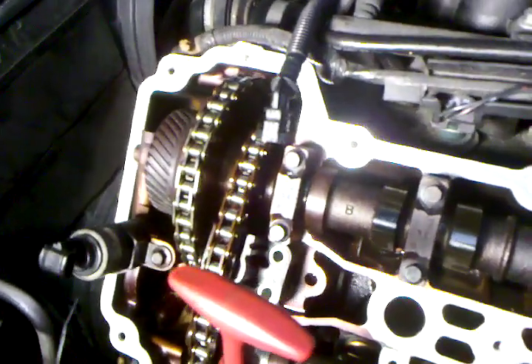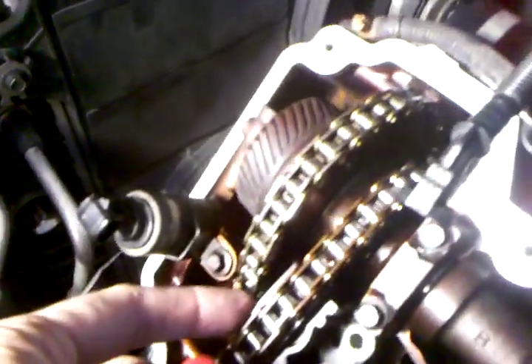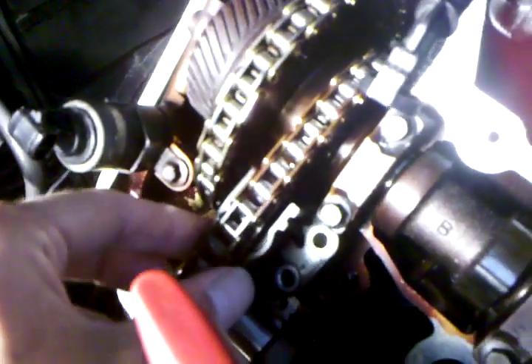Next I'm going to lift up my camshaft so I can get some clearance on this tensioner right here — that's my old tensioner. I'm going to do that with one hand as carefully as I can and lift this up to get some access. The bolts are already out here and here from my old tensioner. There's plenty of play in it as you can see, but I need a little bit more so I can move the chain over.